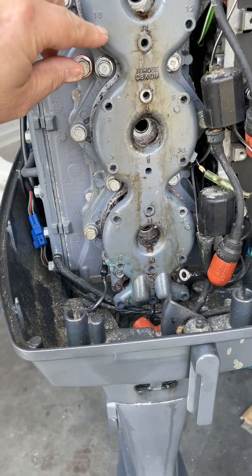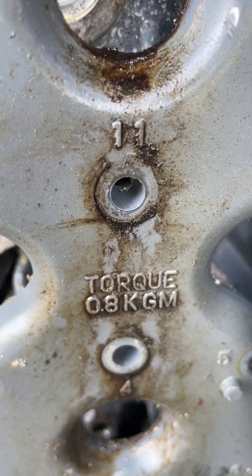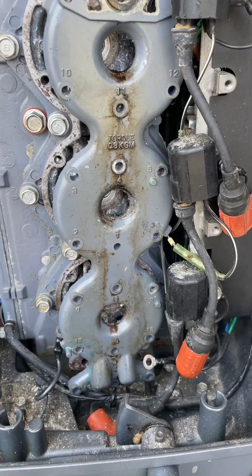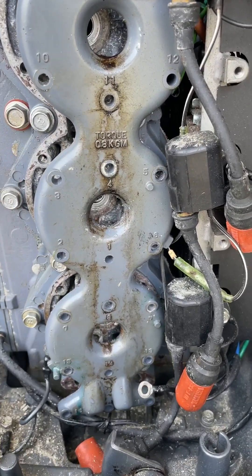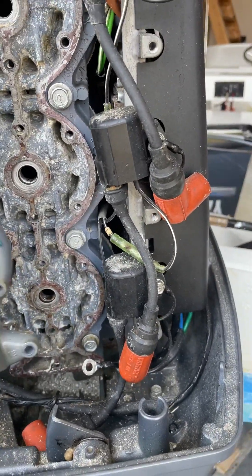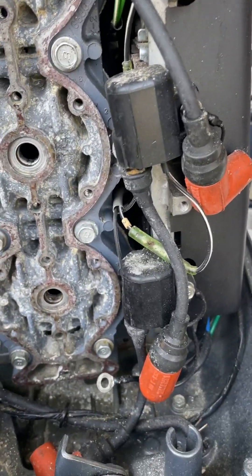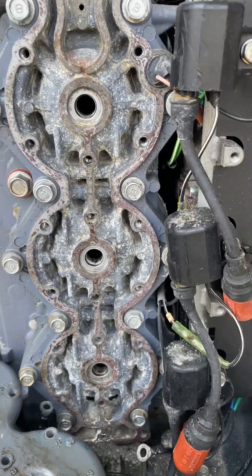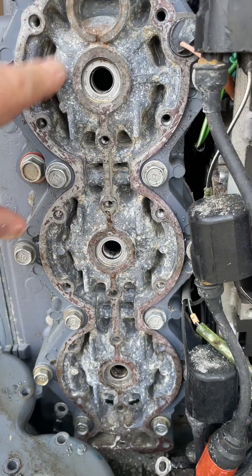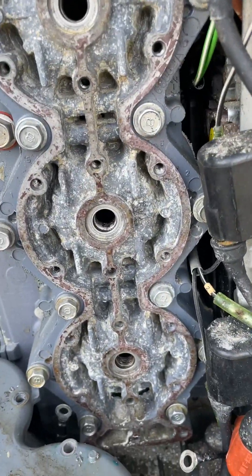There's a bunch of 10mm bolts. They're not on there very tight. The torque is 0.8 kilograms per meter, so they come out very easily. You first take off the thermostat, which belongs up here, and then we use a screwdriver and a wire brush and a little pick to clean out all the deposits in these tubes. This part here is the cylinder head, so we just took the head cover off and cleaned all this out.